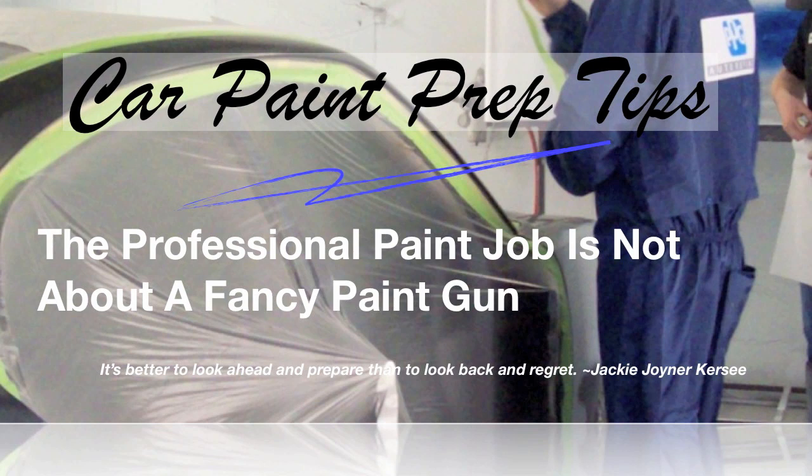You want to get silicones off. Silicones come from wax — anytime you wax your car, you're going to have silicone on there. Just from the environment, driving behind a diesel, or using Armor All on your tires or interior, the silicones become airborne and stick to your paint. It's necessary to get that off. If you don't, you're going to have problems like fish eyes when you go to paint, or paint failures. These problems can be eliminated.